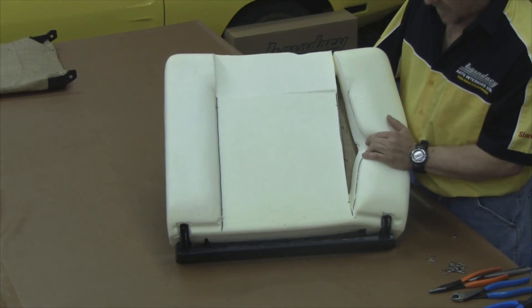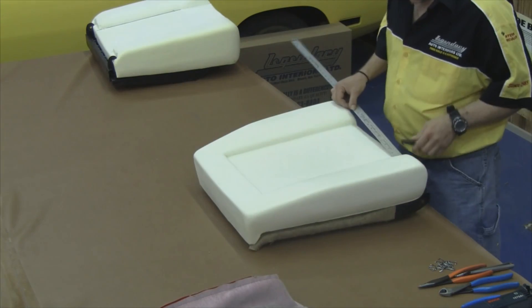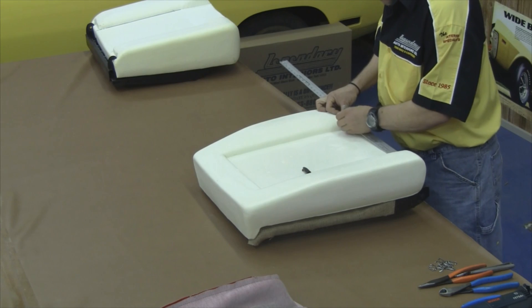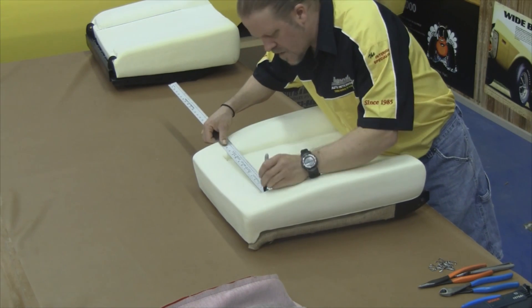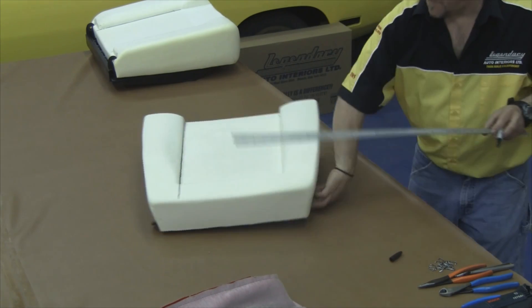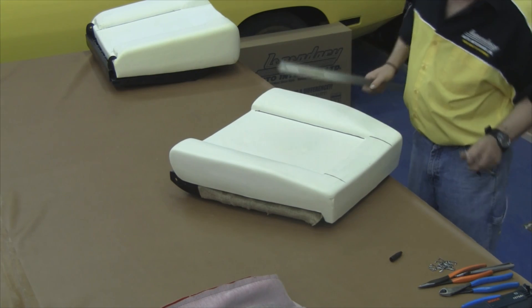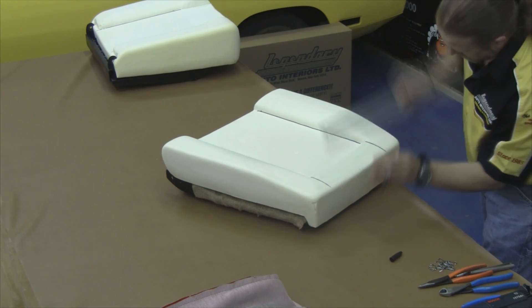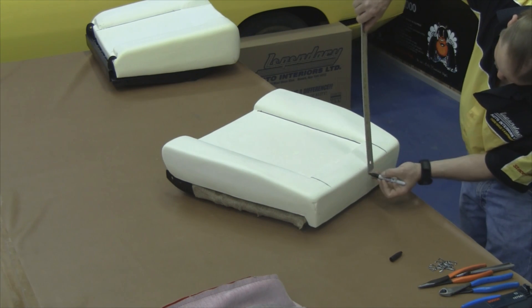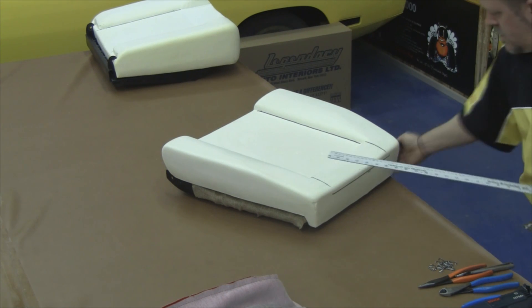After you set your molded foam on top of our seat springs, you should be able to peek down through where we've made our cuts and see your paper-coated listing wire. Now that our front seat bottom is ready for our seat cover, we want to measure the seat cover on our front seat top on the lower end and the upper end to make sure that there's not a taper to our insert. We want to make those same dimension markings on our molded foam and draw the lines where they need to be cut, just like we did on our front seat bottom. The bottom edge of our front seat top width and the back edge of our front seat bottom width should be the same for the insert lines to line up. We want to measure the height of that bolster and come down that same distance, because our goal is to cut that raised-up bolster off the top edge so the insert section of the seat lays completely flat.